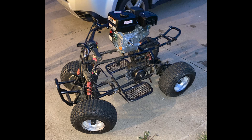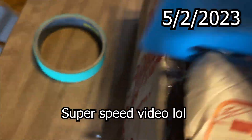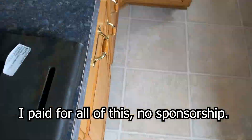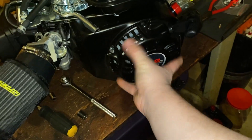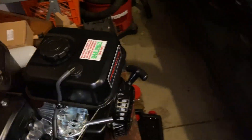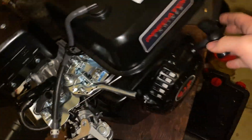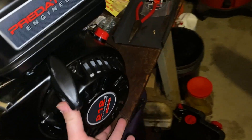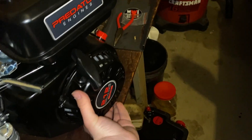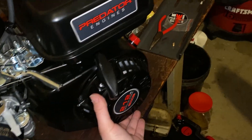Here's a photo of the four-wheeler completely gutted out. We left the driven pulley of the CVT in so we can use it as the driven pulley for the torque converter. The parts I'm unboxing consist of a stage one kit for the motor, a custom exhaust, and the driver pulley for the torque converter — which is technically a clutch. Here's the driver. I also need mounting hardware and an air filter upgrade. All these parts are bigger in person — really nice. We're going to flip the pull start around so that when you're on the bike you can pull it from here instead of reaching over. Shout out Cars and Cameras, and obviously Go Power Sports.